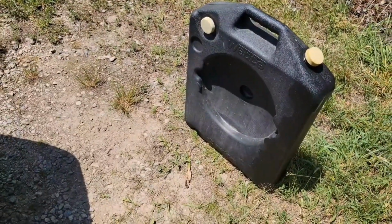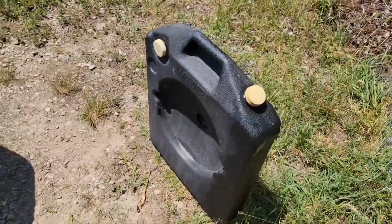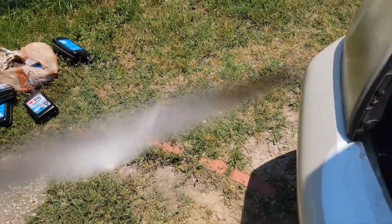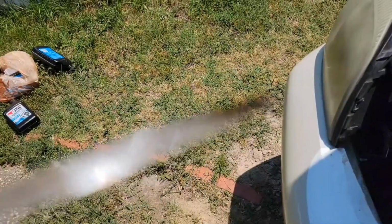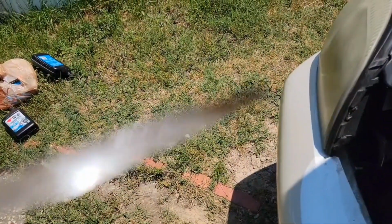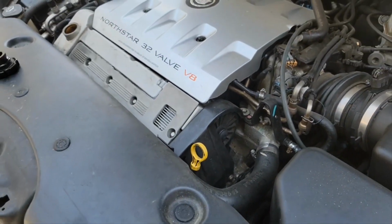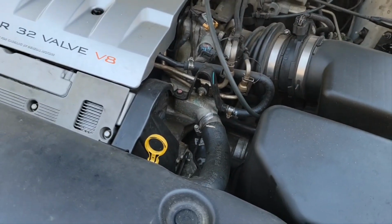I only tried one once or twice, and it just made a big mess. And that's why I stick with the restaurant pan. Okay, this isn't even touching the hatch mark, so it looks like it could use another half a quart. Okay, I got it about 1/4 of the way up into the hatch mark, so I'm going to put my oil cap back on and leave it.